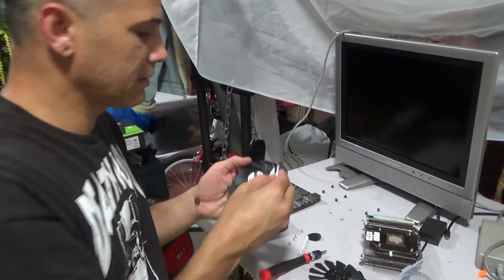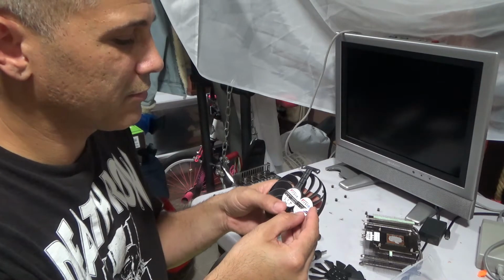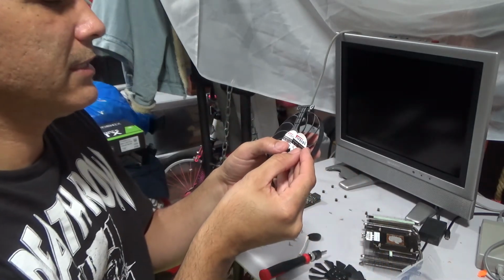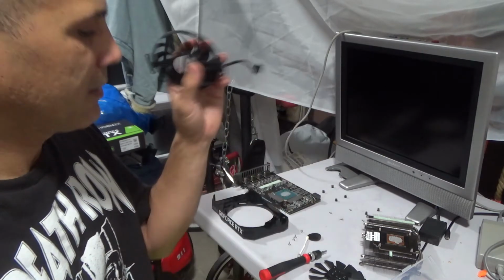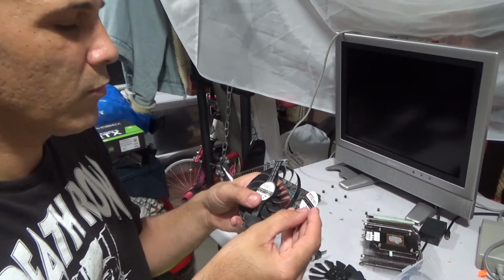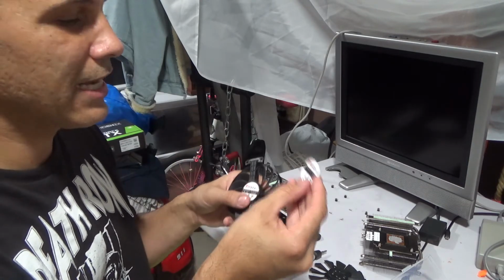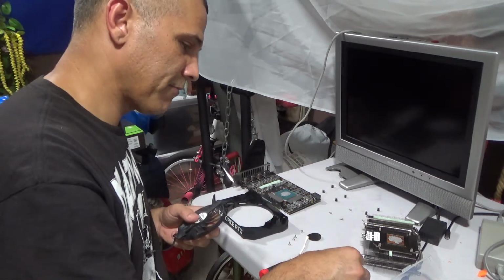So one of the things I noticed, looking at the serial numbers, I have to check online. I'm sure I ordered the right one. I looked at the serial numbers. It's one digit different from the two fans. It says FDC10U12D9C. That's the original one. The other one says FDC10U12S9, not D9. See, D9 is the original. S9, this is the new one. S9C. So it's not the right fan for this.